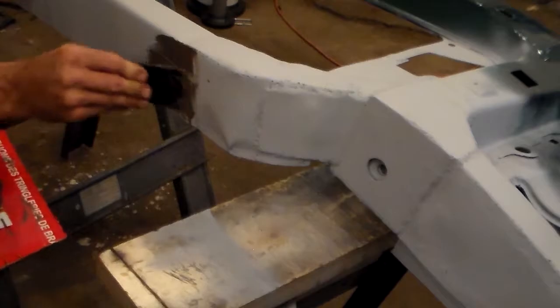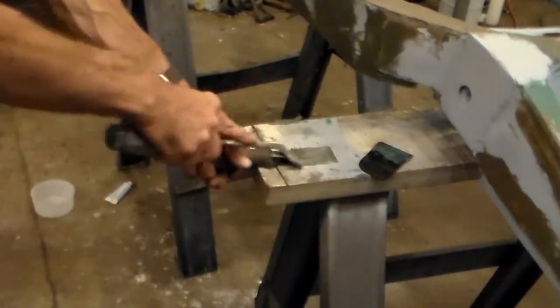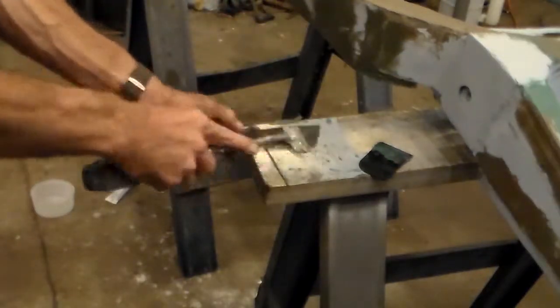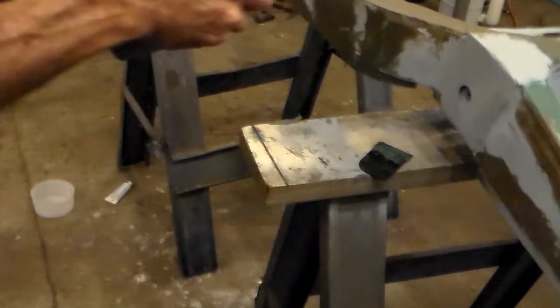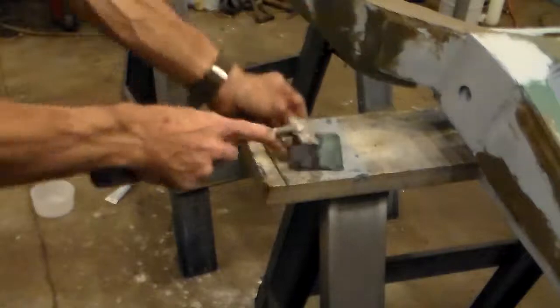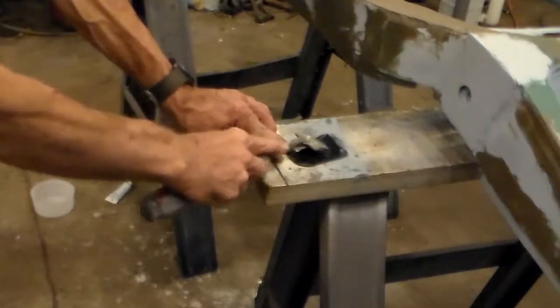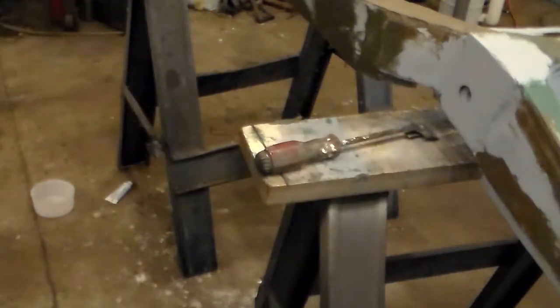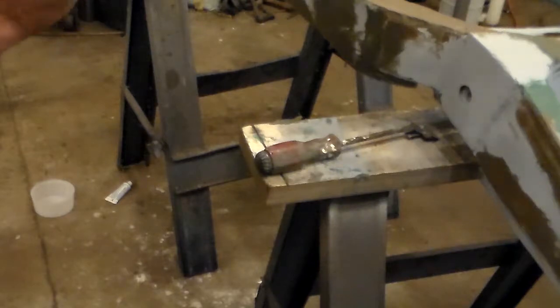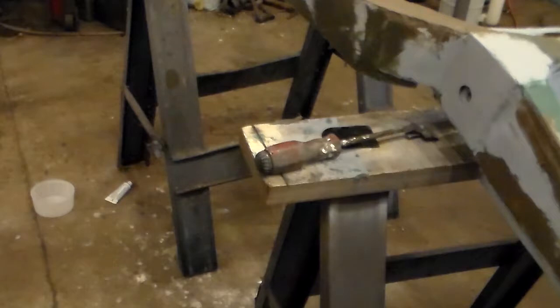Between applications, just take a razor blade and scrape it off — you don't want to put it back in the can, or you'll ruin the can. Same with your applicator. I actually took one large applicator and cut it in half to make two, and you can rotate back and forth — let one harden because once it's hardened it slides right off easy.